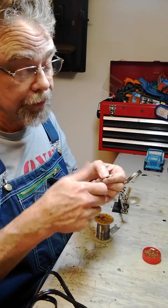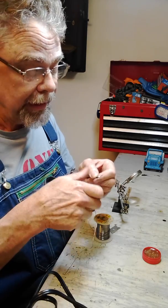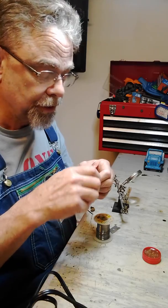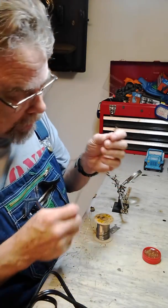And then lastly, also a crimp connector, if you crimp them, people tend to over crimp them, and then the wires break. I mean, they just crush those fine copper wires, and pretty soon the terminal will break off. So this is a nice strong solder joint.